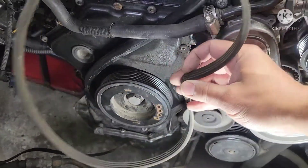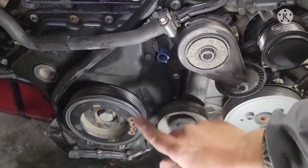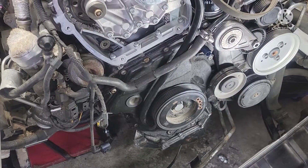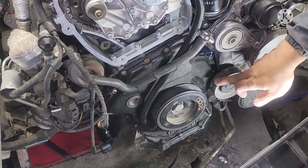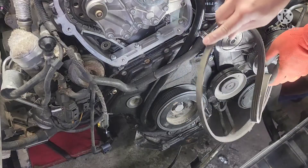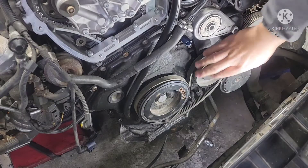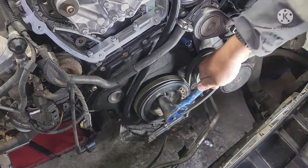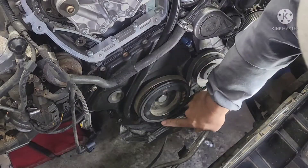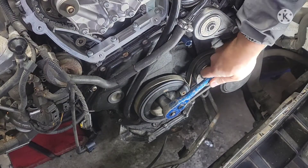What I'm going to do is route a belt in here — just a good old belt from the garage, like a power steering belt, this tiny little one. This pulley turns clockwise, so we're going to tighten the bolt going clockwise. I'll route this belt around the idler pulley, just bend it in half. You can see when we spin the crank it gouges into that little bend on the belt, and that's going to hold the crank pulley steady.